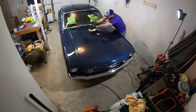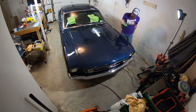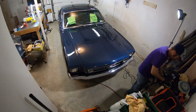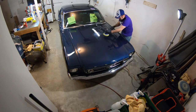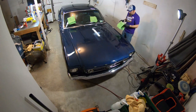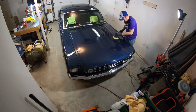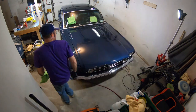Back to the Duetto again — this is hands down my favorite combination for polishing a car and really fine-tuning the finish. I like the form factor of the Duetto; it's easier to hold with one hand if you have to. With the Rupes yellow pad and Meguiar's 205, just take your time, do small sections, and really dial in that paint. The Duetto is also a little less fatiguing than the 21 Mark III and smoother because of the smaller throw.